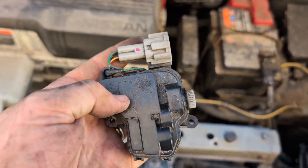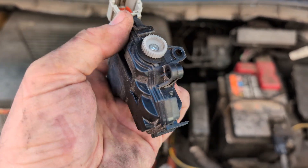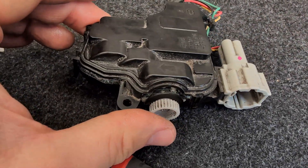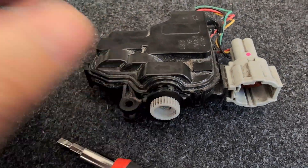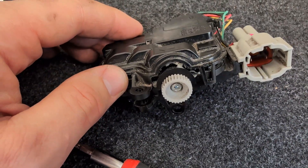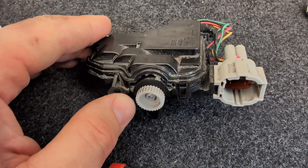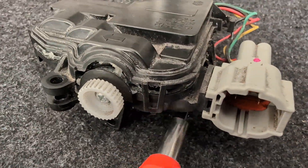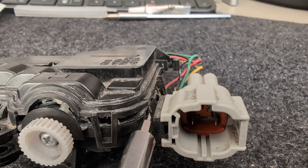The module is about 500 pounds to replace. We'll open it and show you how to repair it. It doesn't have any screws because it's a sealed unit; however, the glue is heat-activated. You can use a hair dryer — just warm it up all around and the glue will be much easier to remove. Start by wedging a small flat screwdriver in this location and put it under this lip.